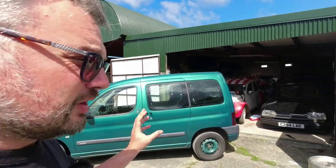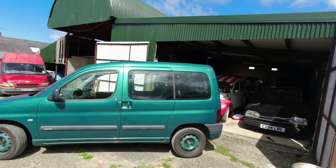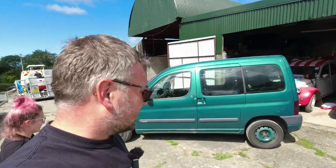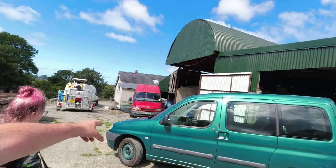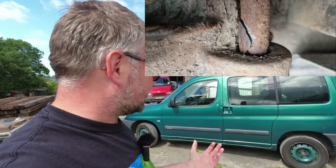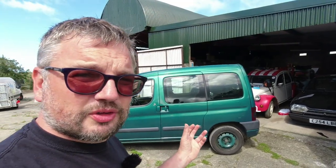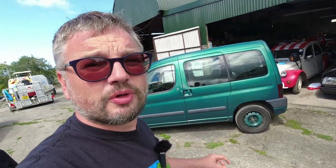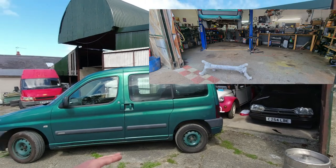The main one — as you will have seen in the last Bella video — she snapped, or the rear suspension collapsed. We didn't actually know why at first. We took it to Wern Garage, DS Motors near Newquay. It's the second job they'd done for us, having already done the timing belt. They replaced the rear axle because it turned out she had snapped a torsion bar. The torsion bars are steel going into an aluminium suspension arm, and the electrolytic reaction between the two is a known weak point, which is why complete rear axles for a Berlingo or Peugeot Partner are easy to obtain.